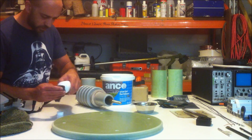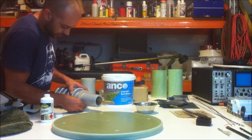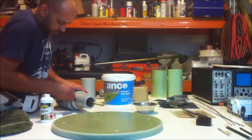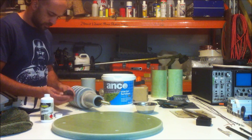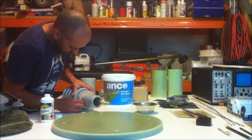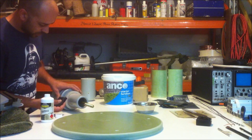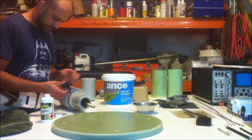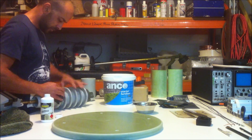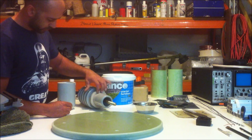It probably wouldn't be a bad idea to wear some gloves just in case there's a little bit of asbestos baked into the gasketing compound, but we'll just keep going. There we go — that's pretty clean. A bit of a wipe down with some acetone. Now that we have the gasket and the gasketing compound all removed from that base, we can do a bit of a trial assembly.